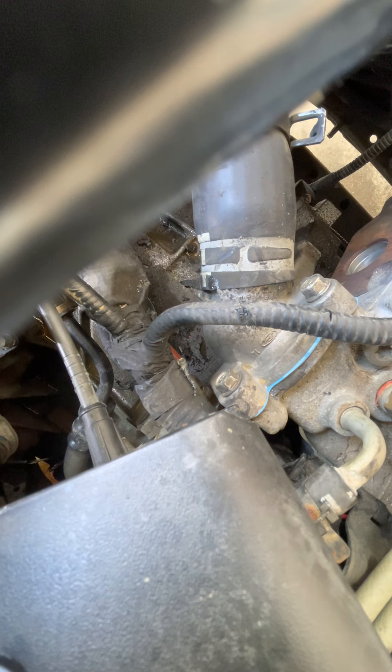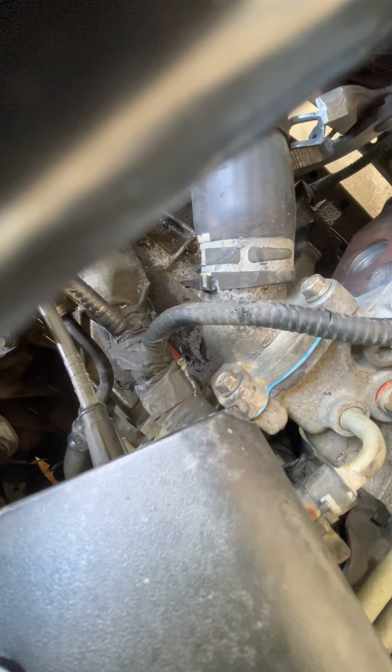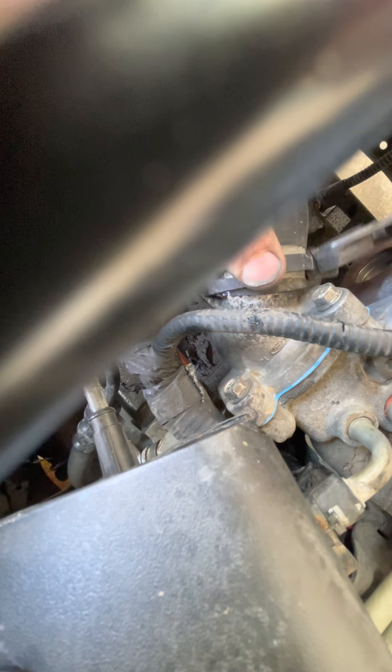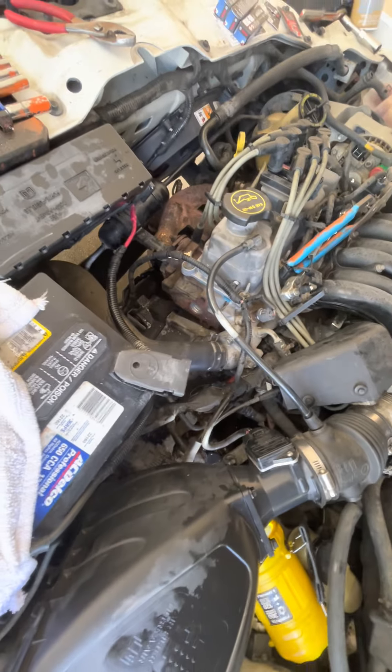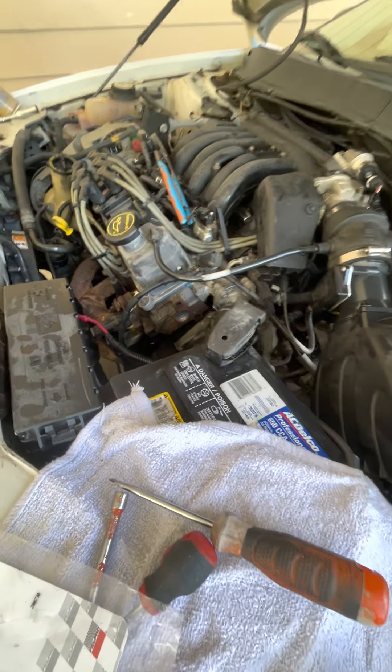So there we go. I've got my channel lock pliers here and I'm going to grab that hose clamp and move it up the engine hose — be careful not to pinch your fingers. Make sure it's flat and make sure it's on there okay. And basically, that's it. Now the real test is does it leak when the car starts? That's the main test — if it leaks when the car starts, you have a problem.